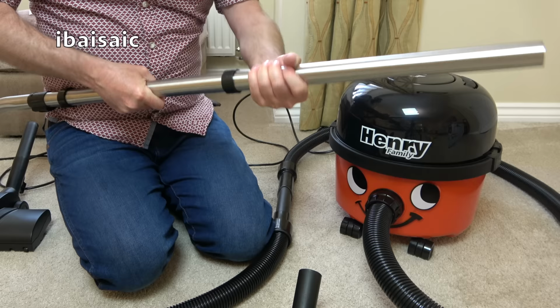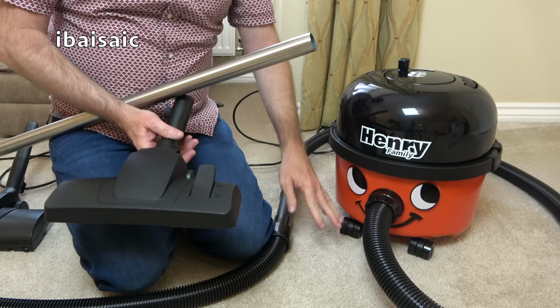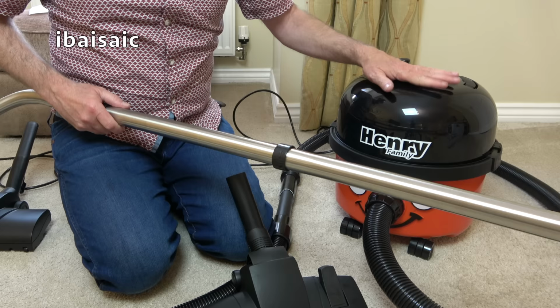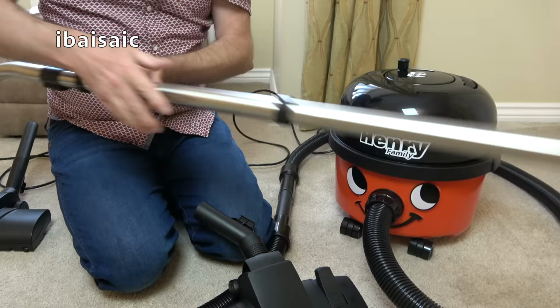Right. Now, I know that this particular carpet, if you've watched my channel for a while, is a Saxony-type carpet. I struggle using many, many vacuums on this. They just stick to the carpet and are very hard to push. So normally, using the straight suction nozzle, I have to use Henry in its reduced suction mode. So I have to turn this to the minus position. Yeah, that's plus. So that's open for minus. So it's less power. But obviously, using the aero brush is a bit easier.